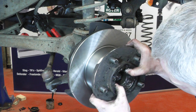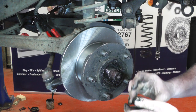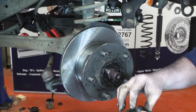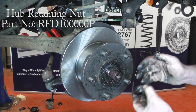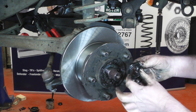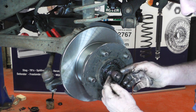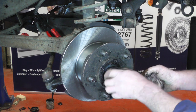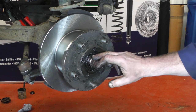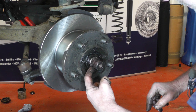It's now a case of replacing the hub and disc assembly back onto the stub axle. Be careful not to damage the seal - put it on nice and straight. We've got the later type nut which replaces the lock nut and tab washer. There's a normal washer with a flat that still needs to go on the flat of the stub axle, and then the new type nut has a built-in lock washer on the side. When you tighten it down, just use a small punch to tap the outside of the shroud onto the flat of the hub as the lock mechanism. Tighten the nut to 210Nm and then tap the tab over onto the flat, then we can replace the drive flange.